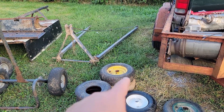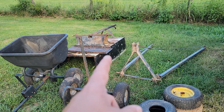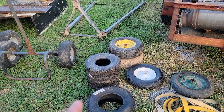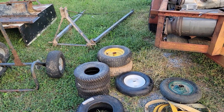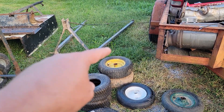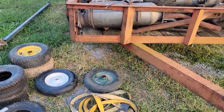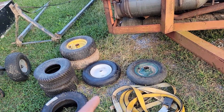I don't know what I'm going to do about the wheels for this big wagon. I may end up trying to sleeve them — maybe do a bronze bushing. I'm assuming it actually had bearings at some point, and that's why it's all wallowed out like that. The bearings gave out and they kept driving it. I don't want wheelbarrow wheels; I want something bigger. But that's for another video.